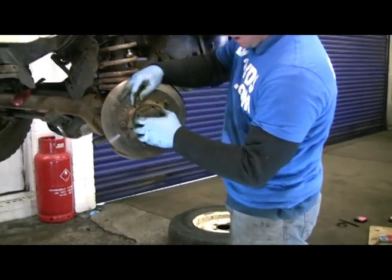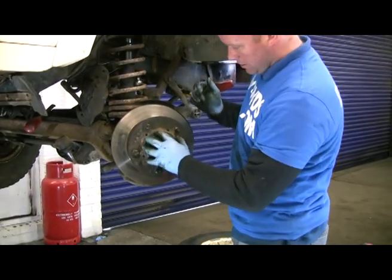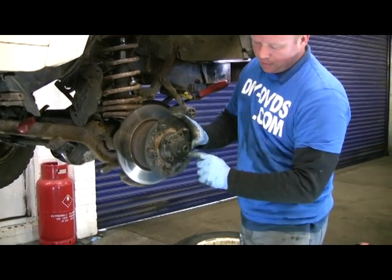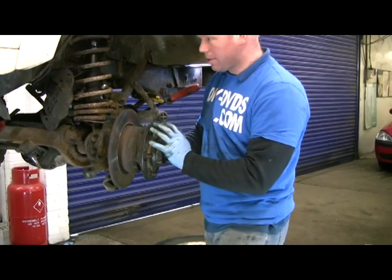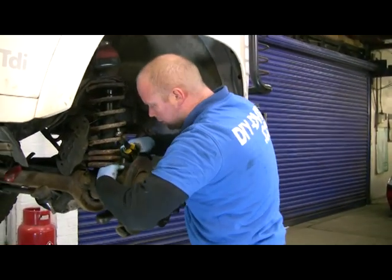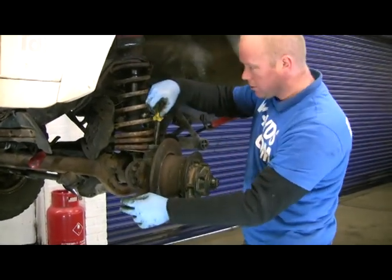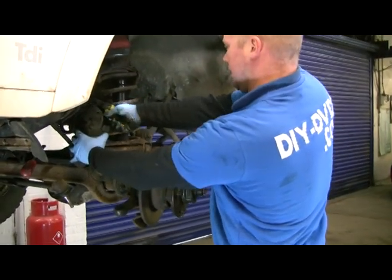Doesn't look anywhere near as bad. Stick that back on. Stick your 5 nuts back in there and your washer, your spacers, and then you circlip it back on that. That's that done, simple, and your dust cap. Take the nut back out of your top swivel housing pin.